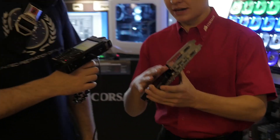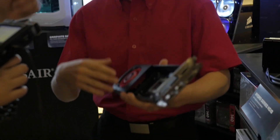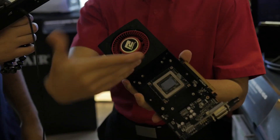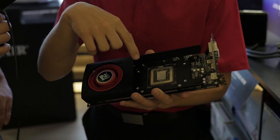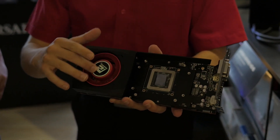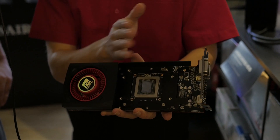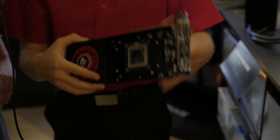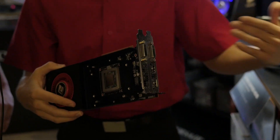Alright, so how does this work as far as the cooling goes? What are you cooling here? So literally, we have this bracket that makes full contact with the VRAM. Look at this — you can see that the VRAMs are fully making contact onto the bracket. We also reused the stock blower right here, so that way it gives it some nice airflow. And then the GPU is cooled by the Hydro Series — H75, H110, whatever.